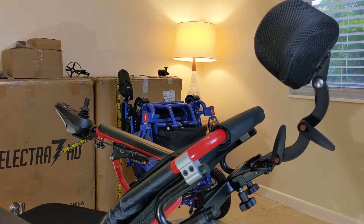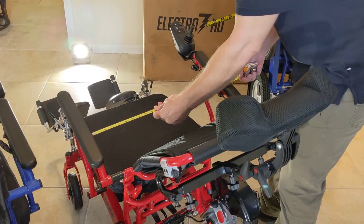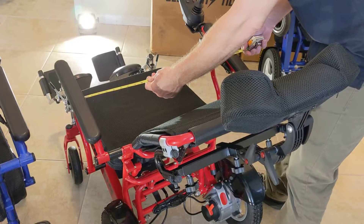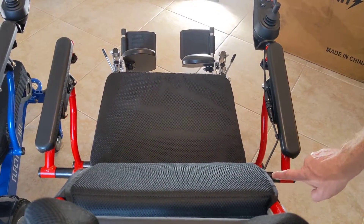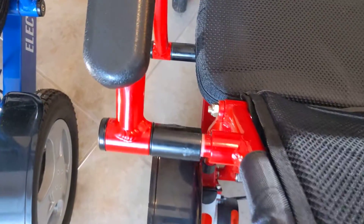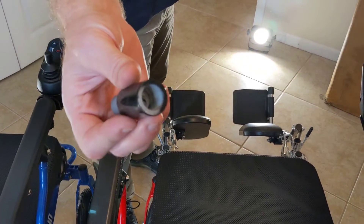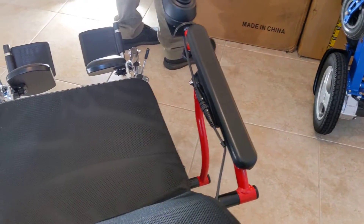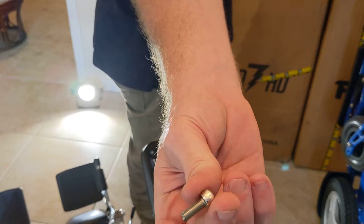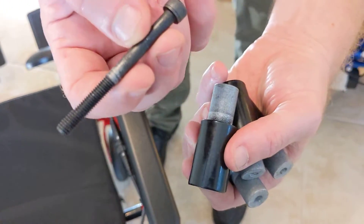The only fallback people were thinking about is that the Falcon had only 18.5 inches of space. However, if we get the armrest extension kit, we're looking at just over 22 inches of space in between the armrests. This HD armrest extension kit comes with four milled parts — each one a single piece of metal, not flimsy plastic inserts. You would remove the armrest screw, which is designed to hold the factory armrests, and replace it with a totally different screw that holds the extender in place.